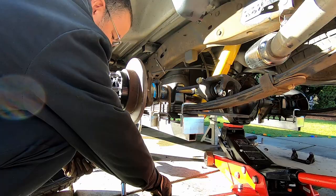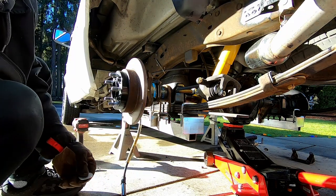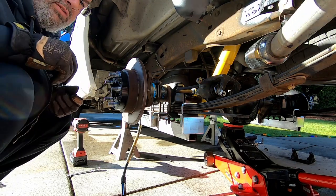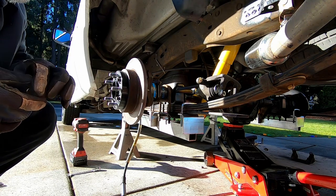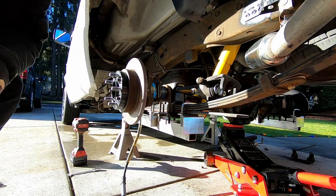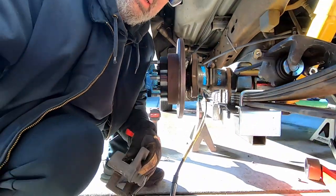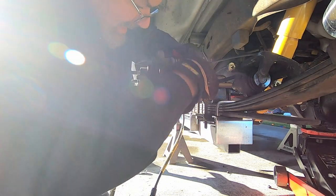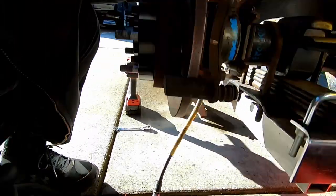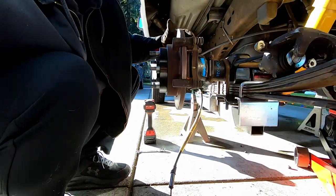I'll hit those with a torque wrench. It's okay to use washers as shims as long as they're dimensionally correct in thickness within a few thousandths of each other — hardware store washers can vary quite a bit. These are actually aircraft washers. I've just hung the washers on the bolts. We're trying to get the rotor centered up in the groove in the caliper mount pads.